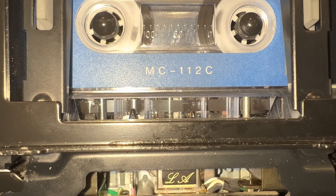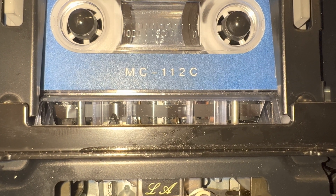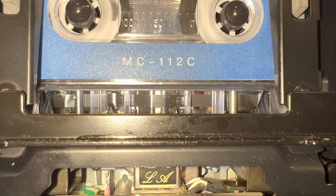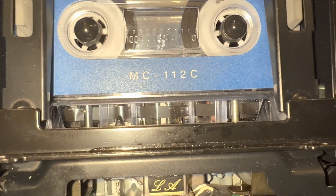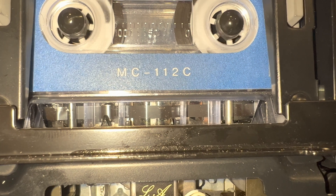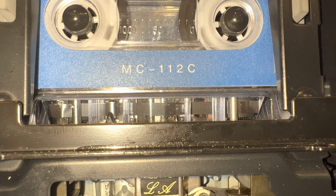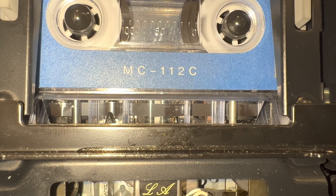Hey guys, this is the factory settings and you may see that the playback and record head seats too low. I will be adjusting it. I made a recording and it was nice, but when I started to play in my other decks, I immediately heard that something was wrong. The wrong thing is that the heads are too low — that's where I need to unscrew and pop it up.